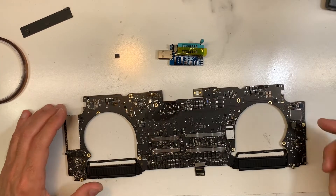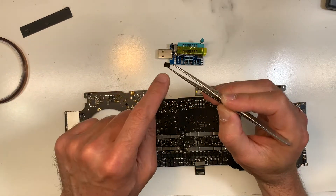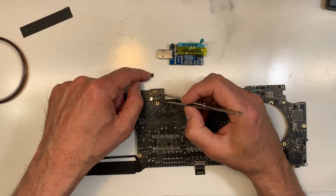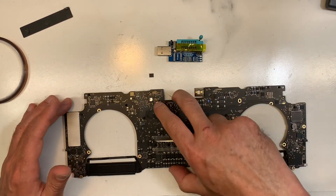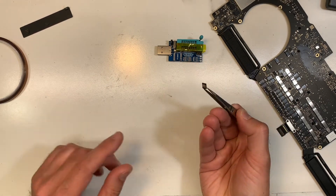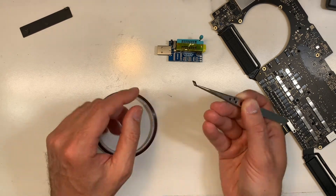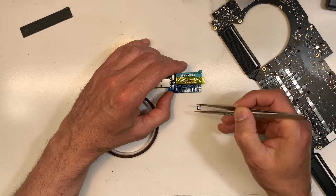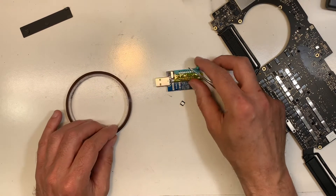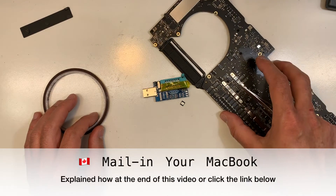I took off the BIOS. There's an orientation on all BIOS chips — pin number one is facing over here. There's a dot indicating pin number one, and it goes over here. On the programmer, pin number one is on this side. The problem with this BIOS is that the leads are short, so I need to make sure I cover it — otherwise the pin will touch and it's going to short. I'm going to go ahead and reprogram the BIOS, then put it back and show you the lock is gone.